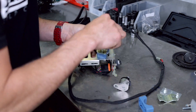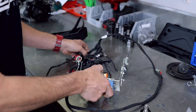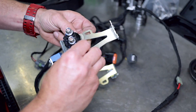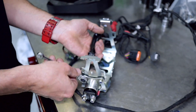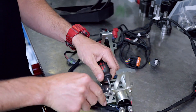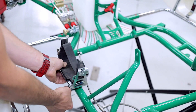So what we've got here is the battery bracket. We're just prepping the brackets here on the bench and then we're going to install it on the cart. We're also going to add the little starting solenoid to the front of the battery bracket — this is two M5 screws. Do them up with the Phillips head screwdriver and an eight millimeter ratchet spanner if you've got one. Test fit the rubber — all good.